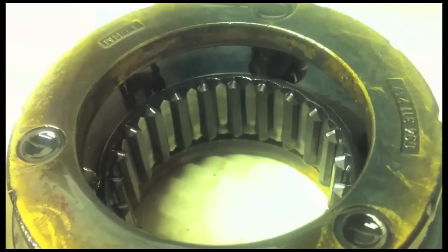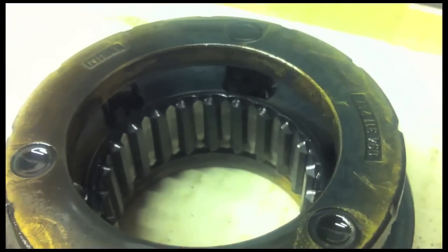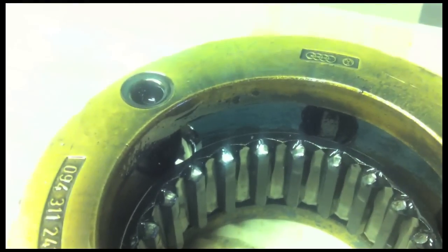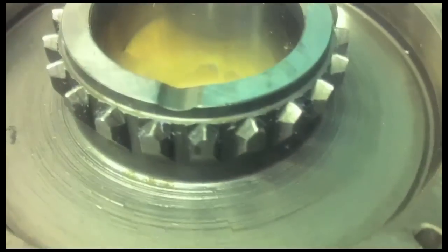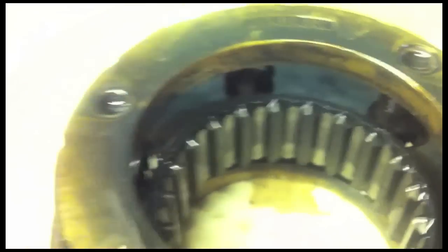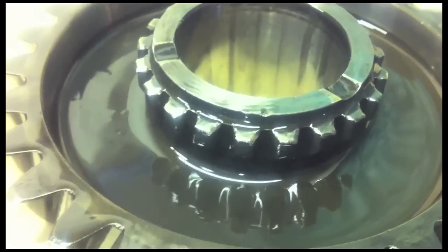So those pointy teeth are the first gear side of the synchro. And that's what they should look like. And your first gear looks just like your nice reverse gear. But your reverse side is all blunt. Yeah, you can see the distinct difference where that has been trying to mate with that, causing all that wear. Very strange. Yeah, the nice fresh pointy teeth on that one should match up with those. So something strange has been going on there with the reverse gear in the box that we've just bought. Very odd.